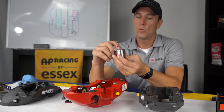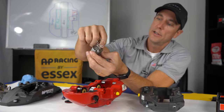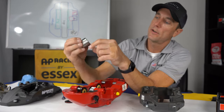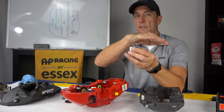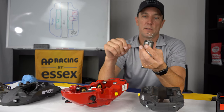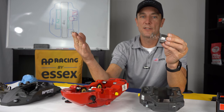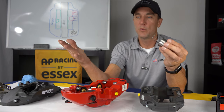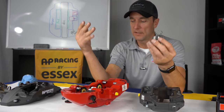The piston also has a domed back. So it's hard to see on here, but if you look really closely, you can see it sort of raised around here. And then on the inside, if you were to look in there, it's got curves. So a dome adds stiffness, rather than a flat back. When we introduced that in pro racing, the drivers noticed it immediately and said, hey, what did you do to the car? They could actually feel that stiffness.